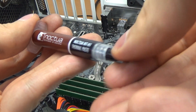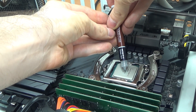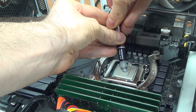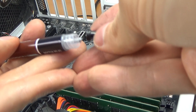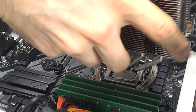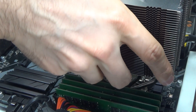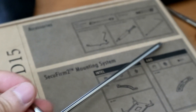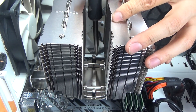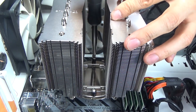Please give the video a thumbs up if it helps. At this point, I made sure to know how to proceed before continuing — if you are installing along, watch the next few steps first. Squeeze a little bit of the NT-H1 thermal paste onto the CPU; the guide says a small drop, 4 to 5 mm diameter, which is between 0.15 and 0.2 inches. Using too much thermal paste makes it less efficient. Now remove the heatsink protection and place the heatsink onto the CPU. A screwdriver tool is included, but you can use your own if it's long and thin enough. The guide recommends making two or three turns on each of the two screws until both are fully tightened gently — don't use excessive force; again, the guide names 0.6 Newton meters, which just tells me don't treat this like IKEA furniture.